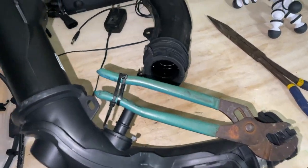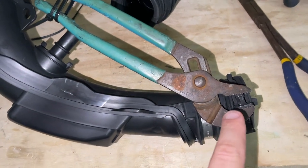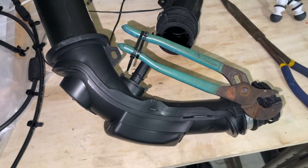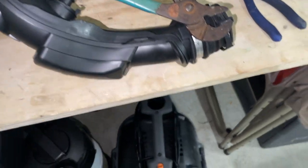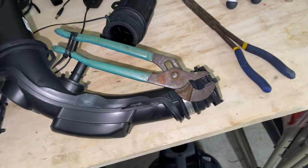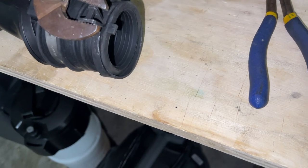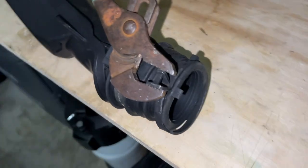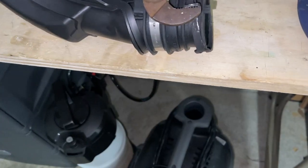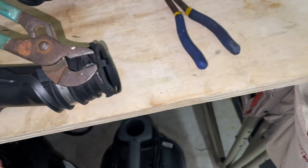This right here is the new tube just arrived. This is what I'm talking about with the pliers — I've got them angled in the same direction as the pipe with two tie wraps. If you get cheap tie wraps you might need more than two. I've done this before — we'll get it in, then cut the tie straps to release the clamp. Make sure your clamp is tilted the right way and pushed down the way it's supposed to be.